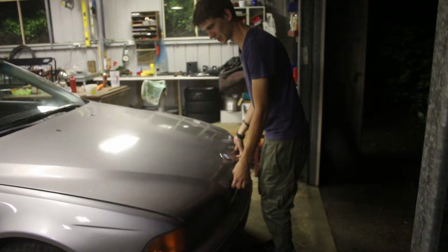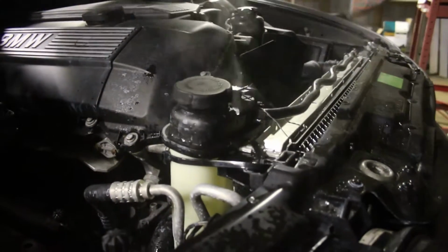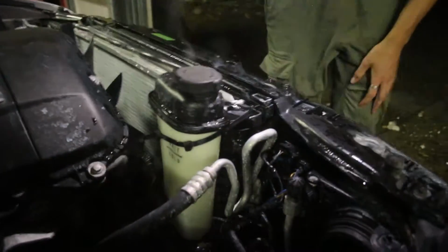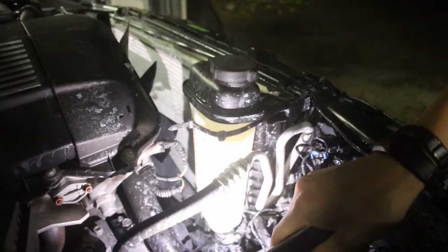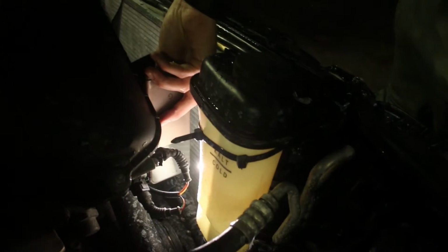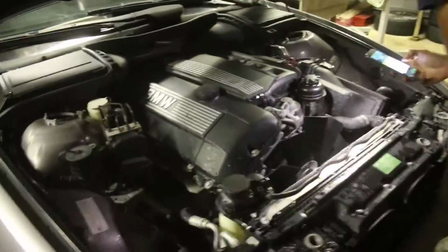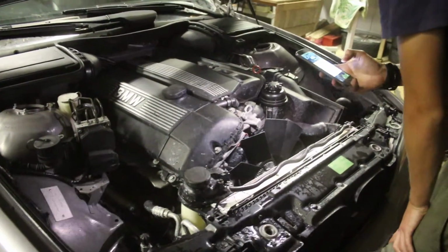Can you pop the bonnet? It's steamy. So that didn't go well. You didn't just blow out a good radiator cap. Okay, so it's coming out of there again. It seems like it's coming out from the cap again. Can you put the thing up against the side of the coolant tank and we'll see how much is in there? On the other side, dickhead, I'm on this side. Yeah, definitely water. There's stuff in there. It's just boiling, so it's definitely circulating, but how much though?